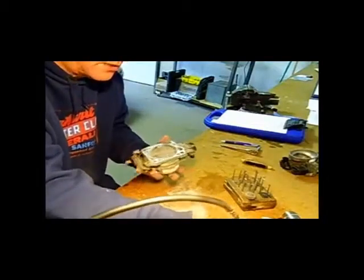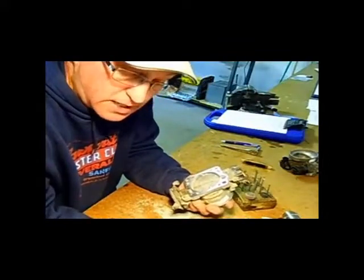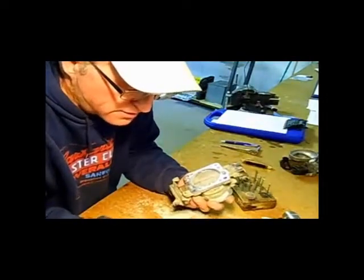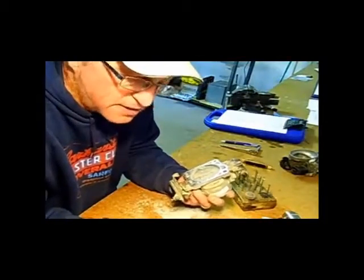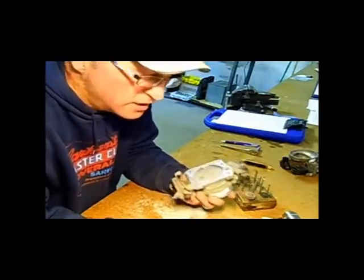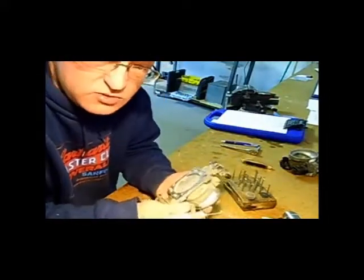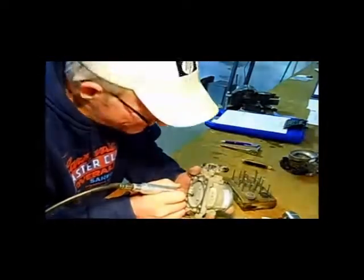Now you want to get your bit into your coolant solution as quickly as possible. Because if you use a hydrocarbon-based solution, you can actually make your bits harder. At least that's the theory, because when they're case hardening or tempering steel, they heat the metal up to a certain point, then allow it to cool in a hydrocarbon or something heavy in carbon. The ancient Japanese used just high carbon ash, which was just wood ash, and they stuck it in there in a warm environment and let it cool off extremely gradually so that the carbon molecules bonded with the metal. Little trivia there for you.